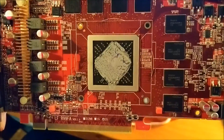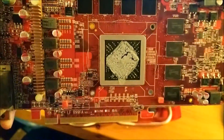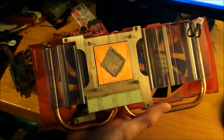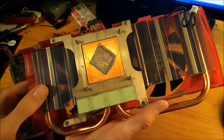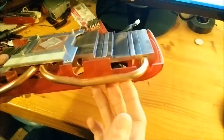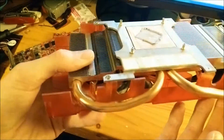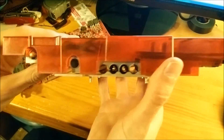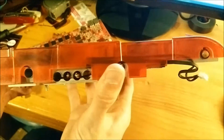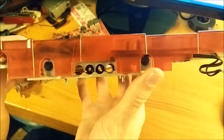There's the GPU — I'm just going to clean off the paste. You can see it's a little bit reflective; the spread on this is actually pretty good. There's a thermal pad on the bottom of the heatsink for only four of the memory modules. You can see the heatsink fins there — it's quite a thin heatsink. There's not much weight to it at all. It is missing a couple of heat pipes on the 6950 compared to the 6970 — as you can see, they've literally just left holes for them, which I find quite amusing.